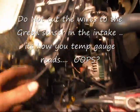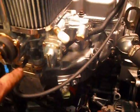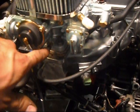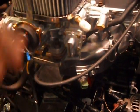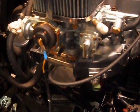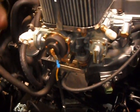There are no vacuum lines — I am only running one vacuum line straight to the vacuum advance. A smart guy next door showed me that this port only has vacuum when you give it throttle because it's above the plate. But since this port is below the plate, it has constant vacuum. What that gave me was a lot faster throttle response, and when the second barrel opened up it just seemed like it took it — instantaneous. Take his word for it.